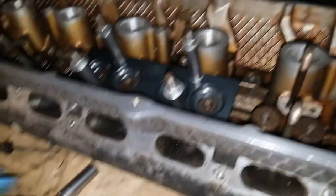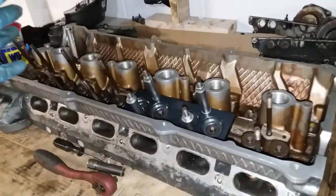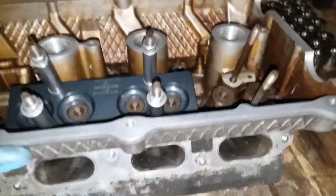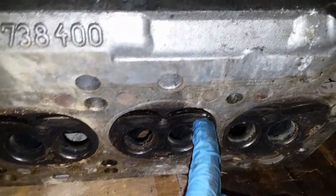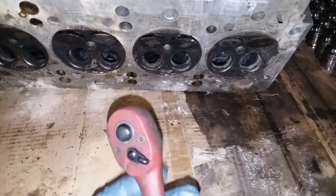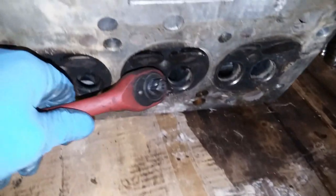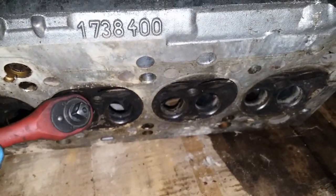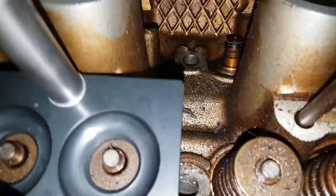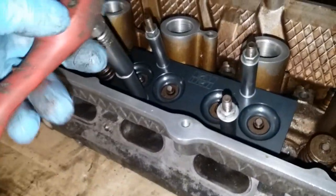Since the cylinder head is off the car, we don't have the luxury of compressed air in the cylinders to hold the valves up. So if the valves are sticking because the keepers are stuck, I'll flip the head up — you can see the valves are somewhat open. They're not seized in the guides, it's just those keepers stuck. Since my ratchet handle is soft material, I'll just do a little brisk smack to close the valves. Sometimes when they're really stuck you gotta give them a decent little whack — nothing crazy — just to loosen up the keepers. That brought them up quite a bit and the keepers are beginning to come out of the retainers.